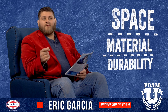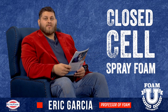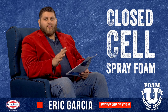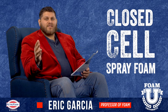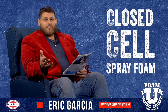So where we land is closed cell spray foam — by far the best option for this. Several reasons. One: space. Like we talked about, space is a big thing for these projects because you don't want to take up a lot of interior room. Two inches of closed cell foam is more than adequate, even if you want to do the top, the bottom, the sides, and back doors — two inches will give you a good barrier and it doesn't take up a ton of space.